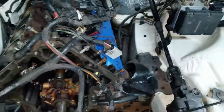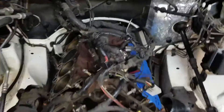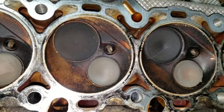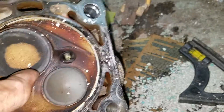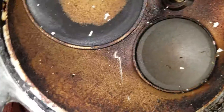Once these cylinders are done they'll get capped off, then the whole block will be removed from the engine compartment. Here's one of the heads - there's one cylinder, another cylinder, another cylinder - and look at that cylinder. That one's starting to look bad. The same exact cylinder on the opposing head is the one that actually dropped the seat.